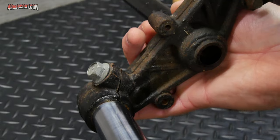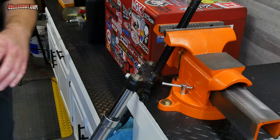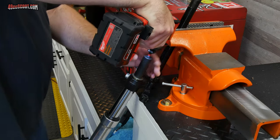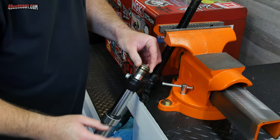Before trying those or replacing the bearings and races, I had a couple of other things to take care of while the front end was apart. The lower section of the stem was getting rusty, so I didn't want to put it back together that way. The shocks needed to come out, so I removed the caps first, remembering that there is spring pressure below them. I also took out the spacer in each fork leg — most of these won't have spacers in stock form, but I added them to mine some time ago.